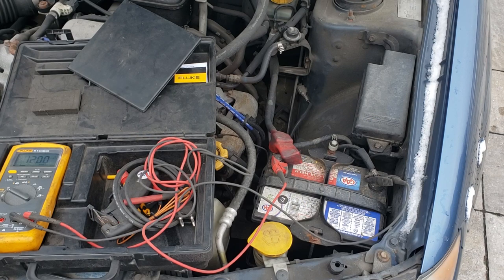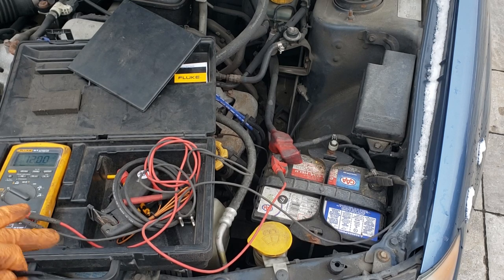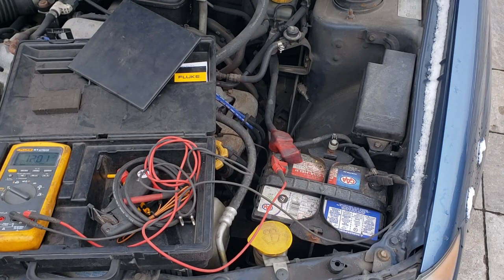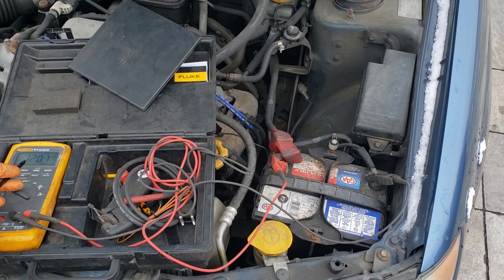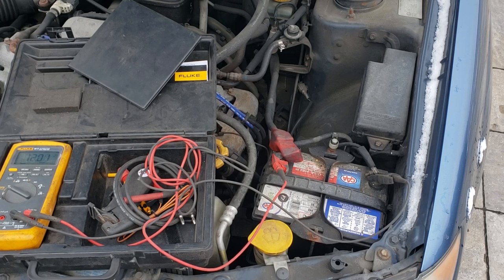You'll need a basic multimeter just to tell you the voltage. You can see we're at 12V, so I'm going to throw the trickle charger on and get it up to 12.65. The battery is in a decent state — it's slowly going back up on its own. Our alternator has let it down. Let's start this thing up and I'll show you that wonderful battery light.